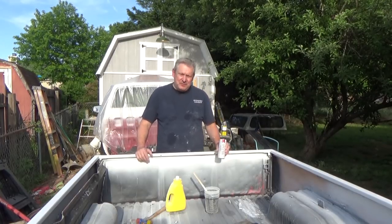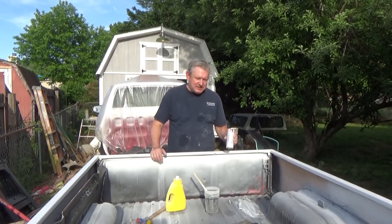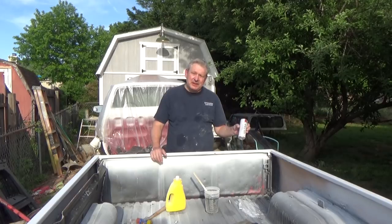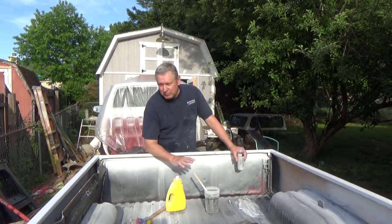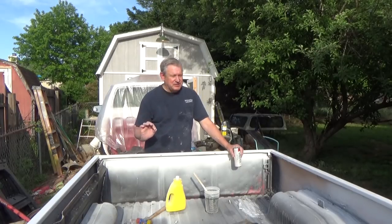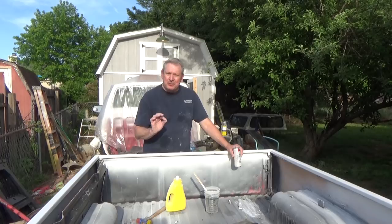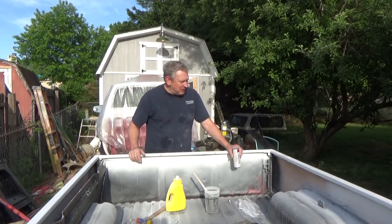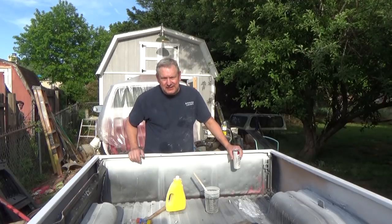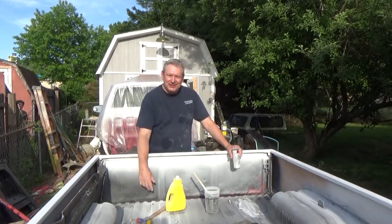It's FMVT — Fat Man Beer Time. I've got most everything wet sanded and it looks really good. I'm going to let it dry, look for imperfections, do a little spot putty on those, and then we should be using the 2K primer — get ready to paint this pig. Awesome! Keep watching to see if we can get this thing put back together. I'm Dave from the Redneck Garage. Keep turning wrenches.